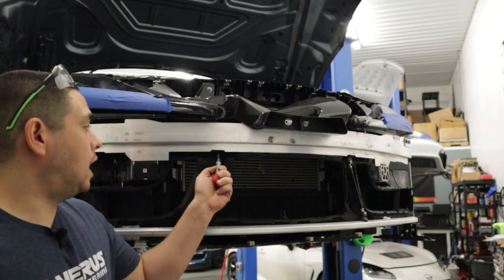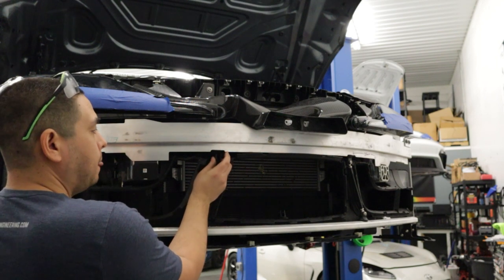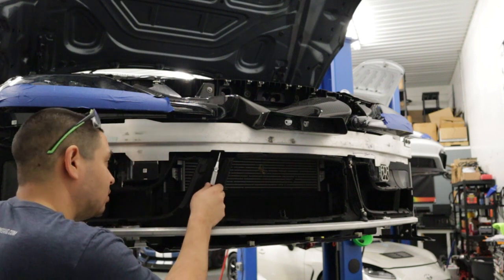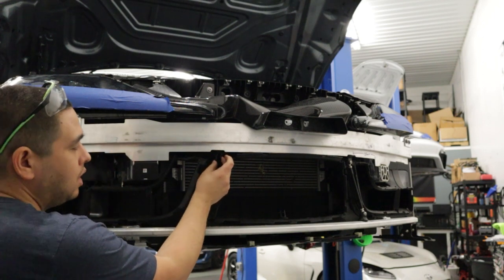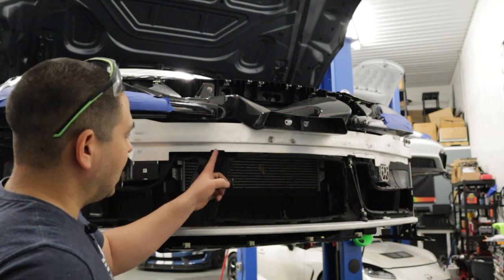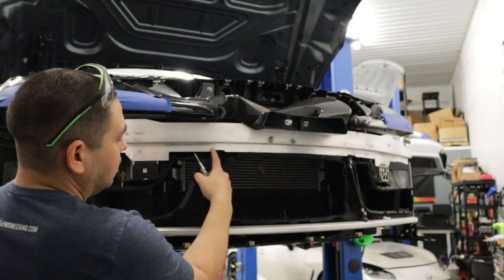We have our little notch cut out or clearanced for our clevis. The clevis is going to kind of stick out a little from the front surface of the bumper, and this will allow you to get the rivet nut that we're about to install into the center of the meat of the crash bar surface down here. When you get your measurement — I believe it was 135 millimeters — you want to measure about a half inch on each side because the diameter of the clevis is about an inch. So that's basically the size of the hole or slot that you need to cut.